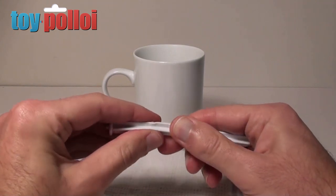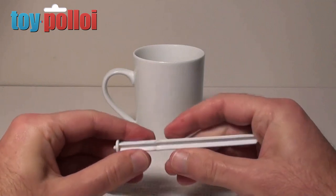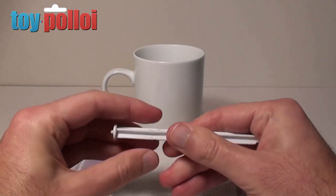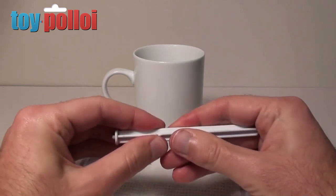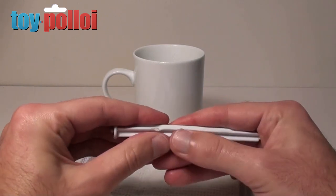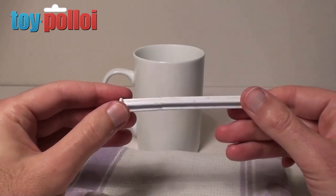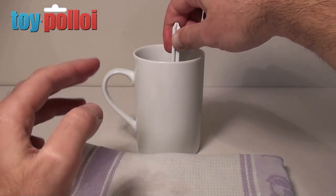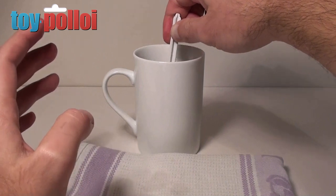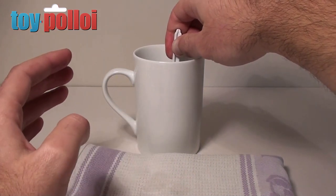Just bend it a little at a time and you will end up getting it pretty straight. It's never going to be perfect — you can never remove all of the marks from this — but you should be able to get it so that it all works and that the Probot base is back to a functioning state. So there you go, that's starting to look pretty straight, so just do it a few more times and we'll get that straightened up. If you do this without using the hot water or warming up the plastic it's more than likely going to snap and then you will have the problem of trying to find a replacement one.